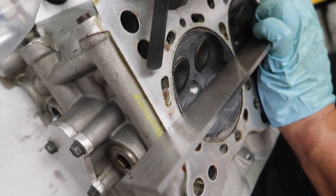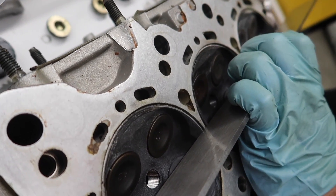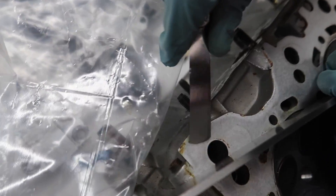You really need to make sure your machine shop knows what they're doing because if they don't, your motor can be completely ruined. After you clean the cylinder head, you use your precision straight edge with a feeler gauge — one and a half thou — and try to see if you can get it to slide in around the chambers. It doesn't go.